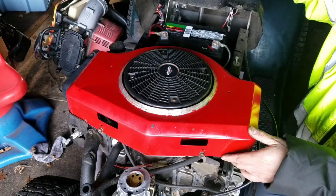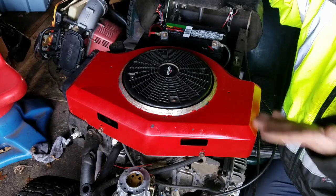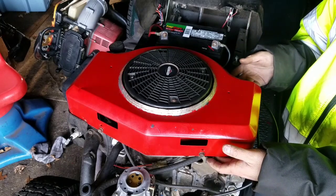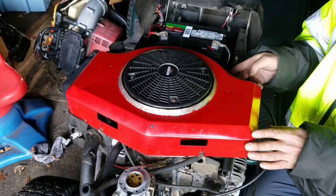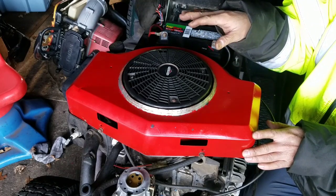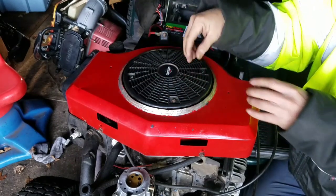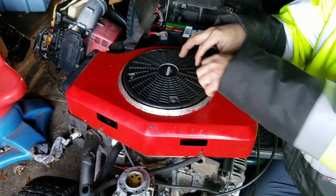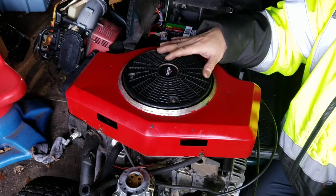What I did was, it just wouldn't fit, you know, it kept on rubbing. So what else can I do? I just have to make it work, right? I mean, look, it's not the space shuttle, right? Just make it work, you know? So the bottom tin underneath the flywheel, I just bent them higher so that the shroud wouldn't hit the plastic fins of the blower fan on the flywheel, right? And then I was going to leave this off, this cage for the air isolator of the grass, you know? This is here so it blows air upwards so that when you're mowing the lawn and the grass comes here, it won't gather in there. It'll blow it away. But then again, you always see grass inside there, right? So obviously it doesn't really work, but it's better than not having it, right?